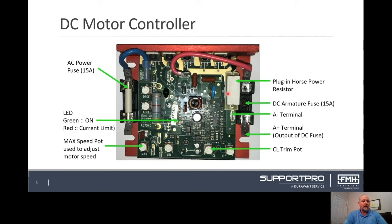There is an indicator light LED module in the center of the board that provides feedback on the state of the board. If the indicator light is lit green, it indicates there is power to the DC controller from the power supply board. It also indicates that the AC fuse is good. It does not supply any indication as to the condition of the DC fuse.